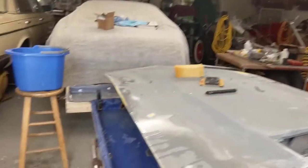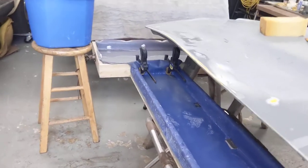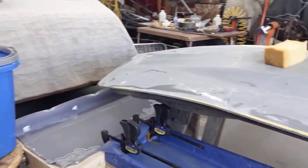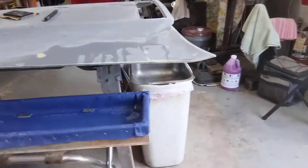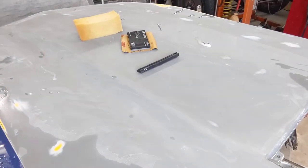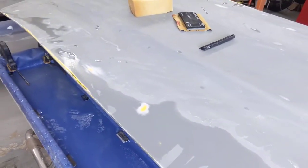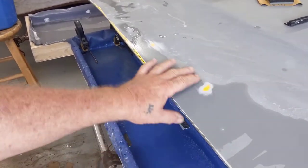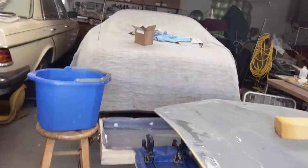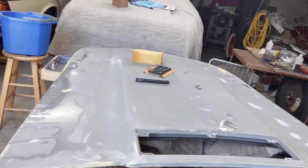Let me show you. You may remember from a previous video the drip pans that we got built by the owner of the car's father — they work out real well. We're here in the shop, no fuss, no mess as we wet sand. Had to fill about 27 little tiny chips throughout the hood. You can probably see those fairly well. Today we've taken it down with 320 grit, got all of it back down to actually into the existing yellow that was there. So we'll have to reseal, but the rest of the car turned out gorgeous — a lot of work on wet sanding and buffing.